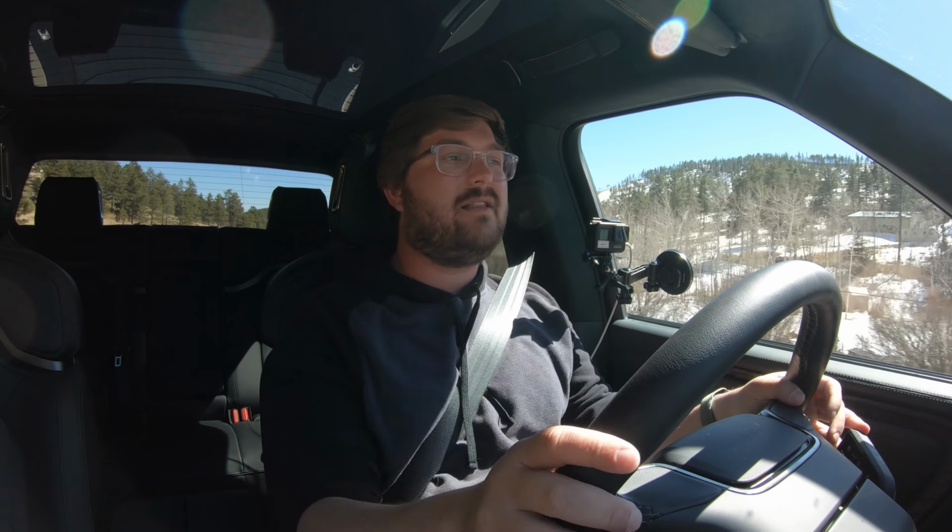Big regen limit here. So I've experienced this a couple times with the vehicle, where it does definitely have some thermal limit, which makes sense. It says regenerative braking reduced, use the brakes to slow down. So that definitely adds up and makes sense. And I can see someone pulling out of their driveway way up ahead, so we're just going to slow down. So you can toast the motors, but it really takes quite a bit of hard driving. And in terms of power, it still outputs full power, just not full regen.